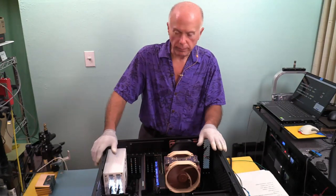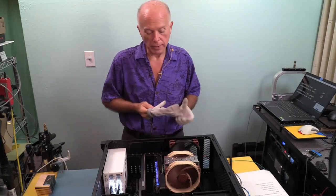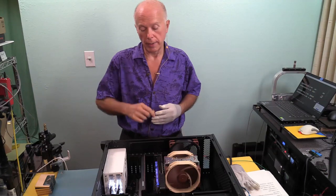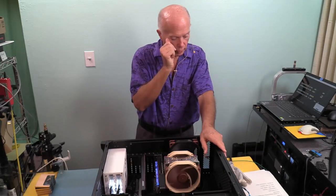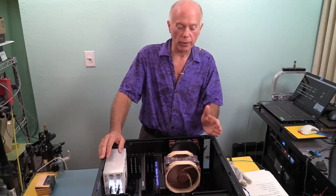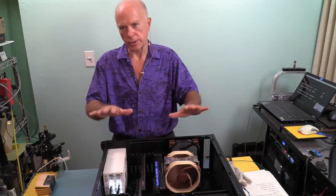Now, while we're waiting on this thing to boot, I think it's important to note that there are 14 TRX40 motherboards. Of those 14, only 5 include some version of an M.2 quad card. And of those 5, only one out of all those motherboards has two add-in cards: one, an M.2 card, and two, a Thunderbolt 3 card. That's this motherboard. That's pretty curious. And as we've reiterated before, for chipsets, this will work with the X299 and the X399. It also works with the TRX40 and the X570. And why do I make that delineation? X299 and X399 are PCI Express 3, whereas if you go TRX40 or X570, you're PCI Express 4.0. So this card will work on any of those machines. That's just something to be aware of.